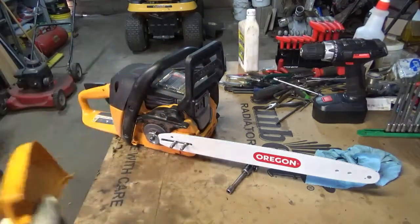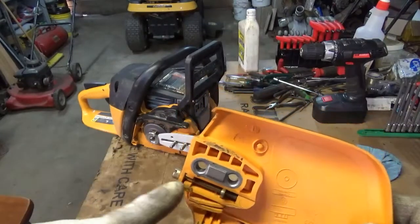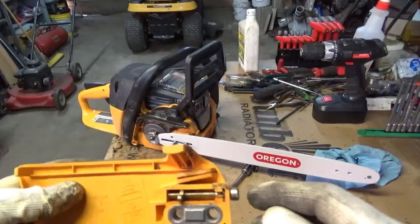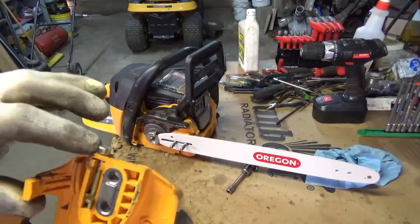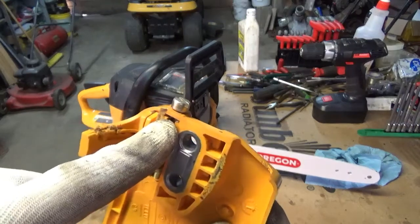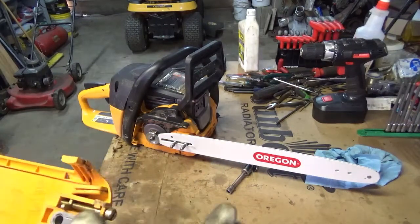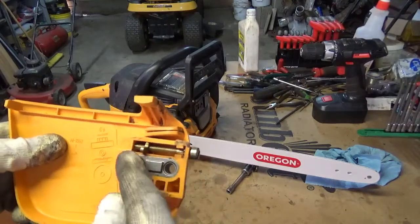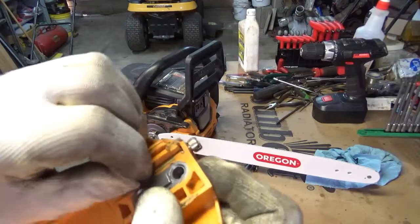So the 4018 does not come with the traditional adjuster jack bolt and pin. It only comes with the bar like you've seen that just came off of it. This is actually for a Poulan 4218 chainsaw that had this style of adjuster in it. All it is is the jack bolt, that little locating pin for the hole, and down in that slot, you can't see it I'm sure, there's a little E-clip that sets down in there that holds it in place. Very straightforward. The boss, the hole and everything was already there, so all I had to do was run the jack bolt in there, thread this on there, set it home, insert the E-clip and snap it into place, and now that is a solid mount. It's not going to go nowhere.